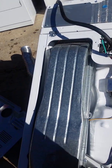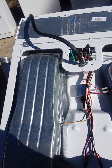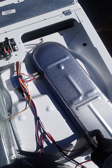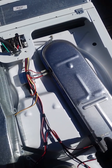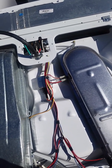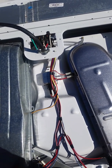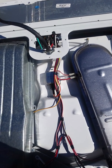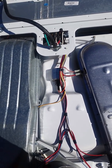Despite all those redundancies, the heating element was probably still on — which is a fire hazard. So be careful. Usually you can tell if a heating element is grounded out: if you open the dryer door, turn the lights off, and you see it glowing red, you know it's grounding out. Just unplug it and that'll solve it.